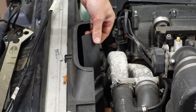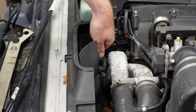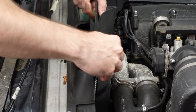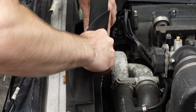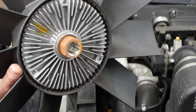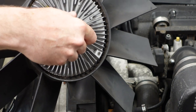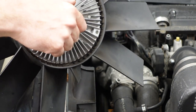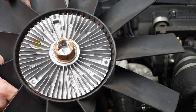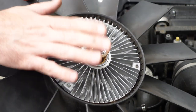Sometimes you got to be a little abrupt. I actually snapped a blade off this fan — I don't know how that happened, maybe from when I was pulling the hood off. Fan is off. Getting the fan out without pulling the shroud is a little difficult. So that's what a viscous fan looks like. The way it works is there's a fluid clutch inside. When the fan gets to a certain RPM, centrifugal force heats it up and it starts to freewheel. At lower RPMs it runs at engine speed to push airflow through the radiator, then freewheels at higher RPMs where wind from the road takes over.